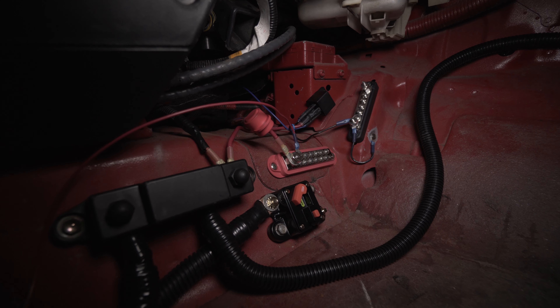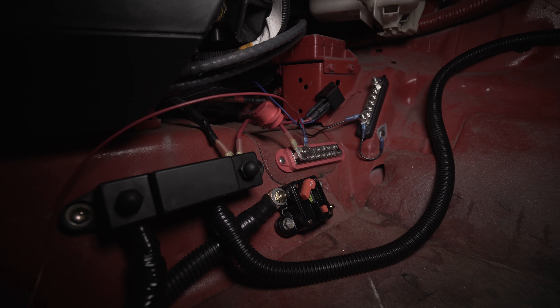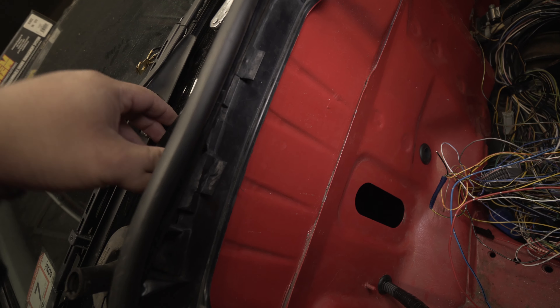This is my dedicated 12-volt line straight from the battery with alternator wiring going back towards the battery. Now that I've been adding gauges and stuff, they need a good source of switched power. So I've tied this relay off to the ignition - as soon as you click on the key, the relay powers up and we've got a switched power source. On top of that we also have a ground bus. All my wires, ECU sensors, and stuff like that will terminate right there.